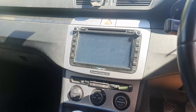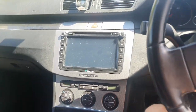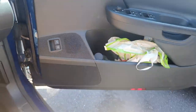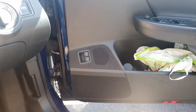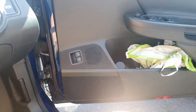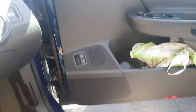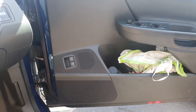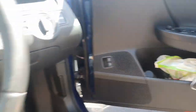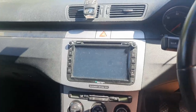If it's got no power, if you've got an amp, check the fuse on the amp and make sure that's actually intact. If not, I suggest taking the whole door card off and seeing if the connections are actually connected to the speaker — probably spade terminals. That might be another thing. But I'm going to take off my door card on the rear because that speaker's got a crackly sort of thing going on and we'll try and work out what's happening.